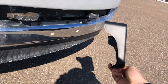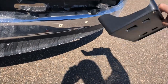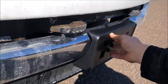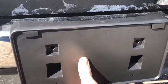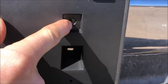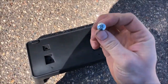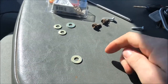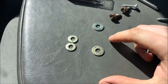Take the bracket — you'll notice the upper portion is a little bit thicker. We're going to rotate this downward so it conforms to the front bumper and the lower front valance. You should have your two upper holes on the bracket lined up with your mounting screws. If these holes seem a little too big and you think the screw heads might pull through, you can put some washers on here, and I'll put a link in the description for those.